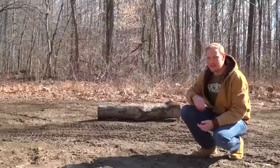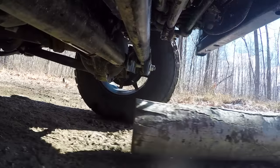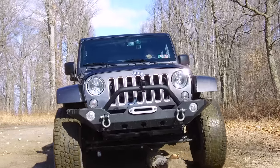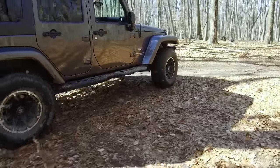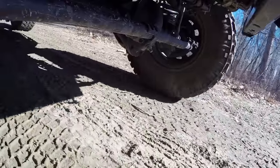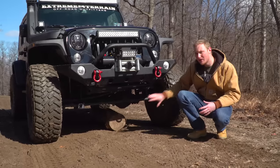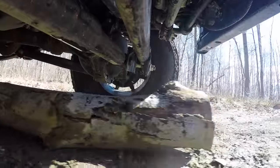Here comes the Sahara with the 33s. As you can see, with the 33-inch tires, we did hit the log with the pumpkin. This is just a log so it's not gonna cause a lot of damage and it'll move out of the way. But on a trail with rocks, or if that was a stump hit at speed, we may have peeled back the differential cover, caused some damage, or at best got hung up and had to back up. Now we'll see how the obstacle is cleared with the 37s to illustrate why larger tires are beneficial off-road. As you can see, there's now plenty of clearance between the bottom of the pumpkin and the obstacle — even with the larger differential on the Rubicon — all thanks to the 37-inch tires versus the 33s.